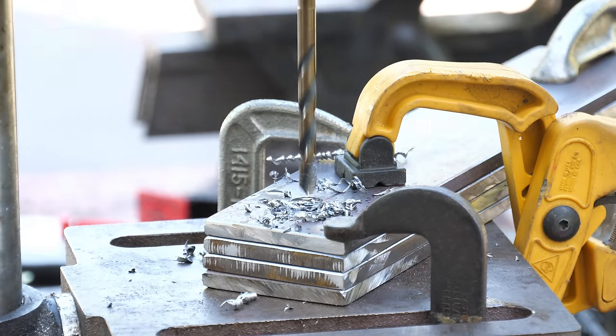With the collector loosely connected, we'll make sure the exhaust is seated in the muffler and tighten those 3 bolts down. And yes, those are nylon lock nuts on there. This is a bit of an experiment. To my surprise, for the last 1,500 miles of the Pinto road trip, it had nylon lock nuts on the collector and they didn't melt, so I wanted to see if this would be any different.